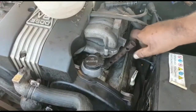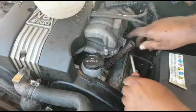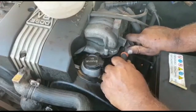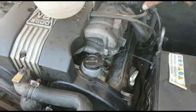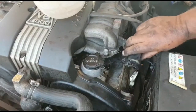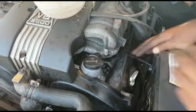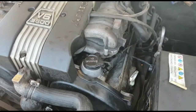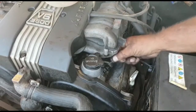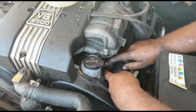And remember, never over tighten it. Never over tighten your spark plug. Here we go, and then that's fine. Just a small little pinch closed, and then we can bring the coil pack back on top. Not too much rocket science going on here. And now we can replace these and fasten the coil packs back on to where they belong.